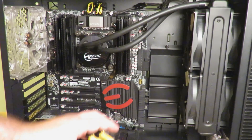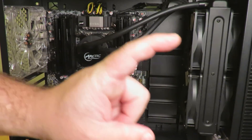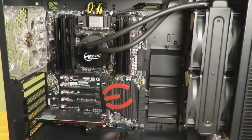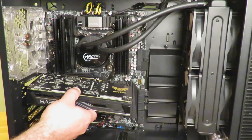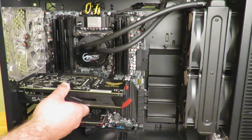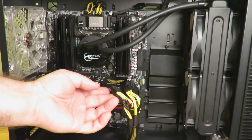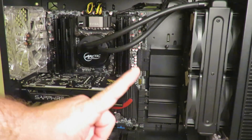One thing I want you to notice while I install the card — that little clip I showed you before is going to go down and back up really quickly. That's letting you know it's locked in; the retention is occurring right here, that little L-bracket piece of plastic is sticking over so you can't pull it out. Just slide it in — that's it, you've installed the video card. You'll need to plug in one of the six-pin PCIe power connectors; I have four on this chain here but you only need one six-pin connector.